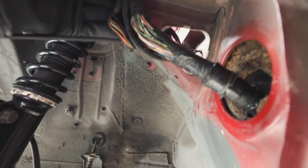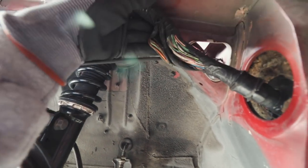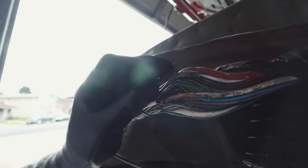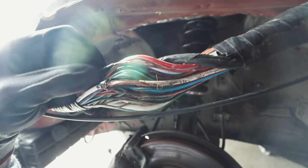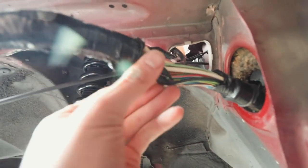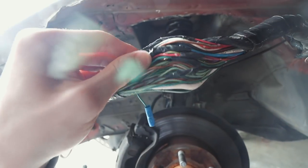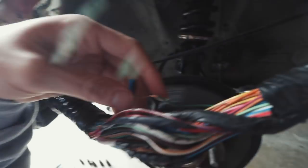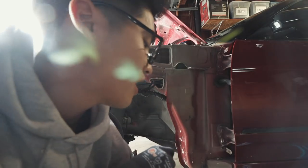On top of that it protects and seals it, which really comes in handy. Before I get to installing it, I'm going to electrical tape the wires that are exposed. As for this wire, it is torn up pretty bad — I'm actually going to repair it instead of just patching the fix. It's better to be safe than sorry so you don't have to come back and do this again. I electrical taped what I needed to. Right here there are these wires I taped off, but I have a couple more — especially this one that's completely disconnected — that I need to solder up.